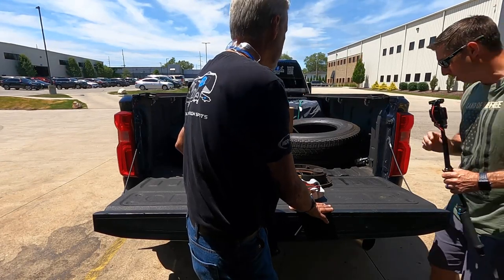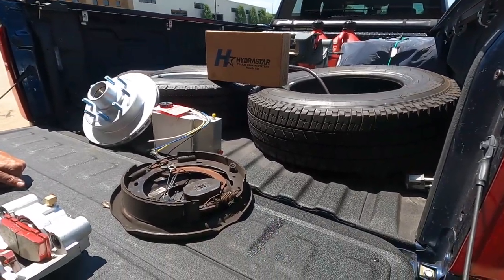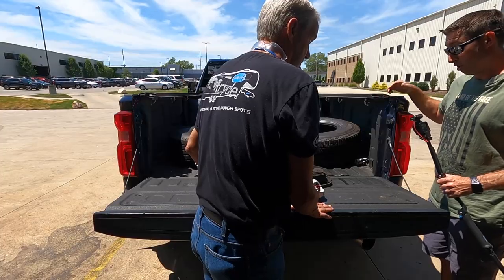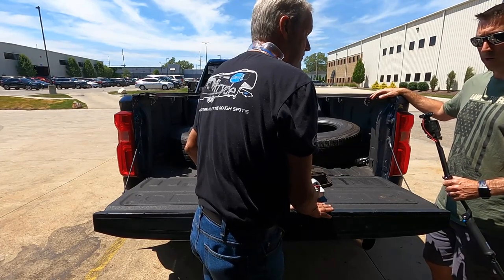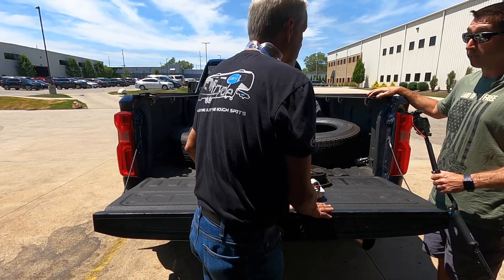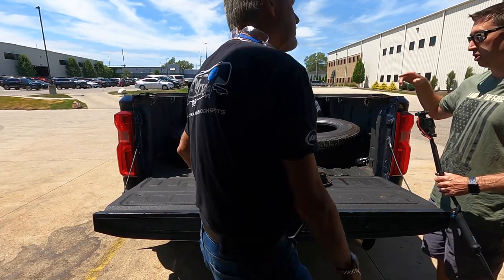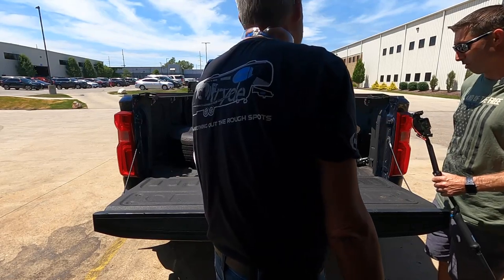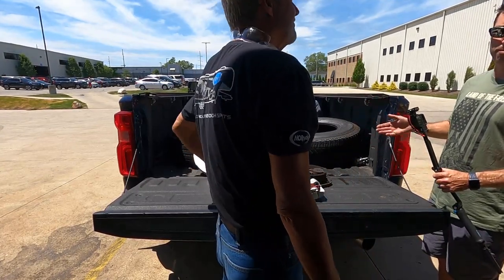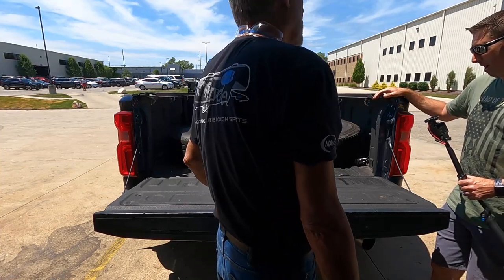It's kind of wild — we literally just picked this trailer up in February and we're already seeing this wear. The drum brakes just aren't that great. I was telling her: the reason she hasn't towed so far is partly my fault, because I'm cranking my gain up to eight to get this thing to stop. She's like, 'I don't want to drive it like that.' With 16,000 pounds behind you, no. I could tell that the trailer pushes us a lot. Sometimes driving around town it's inconsistent — you want one way or the other. With disc brakes, you're going to absolutely love it.